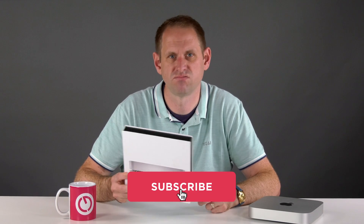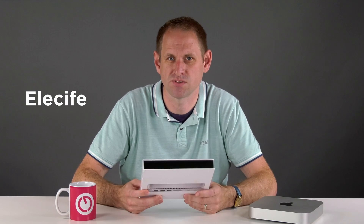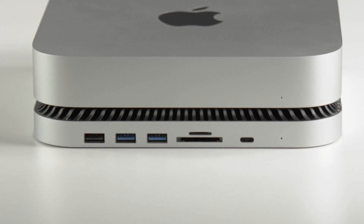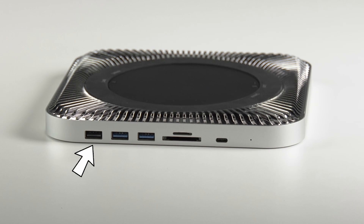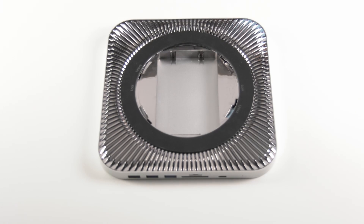This is the Elisif — I'm not sure how it's pronounced, it's spelled like this, so I'll go with Elisif for this video. It's the A5701 and it's designed to sit underneath your M1 Mac Mini or your 2018 Intel Mac Mini, and it matches the look pretty nicely. You get one USB Type-C port on the front, two USB 3 Type-A ports, a USB 2 port, an SD card reader, a micro SD card reader, and in the bottom there's space for a 2.5-inch SATA hard drive. So sounds pretty promising.